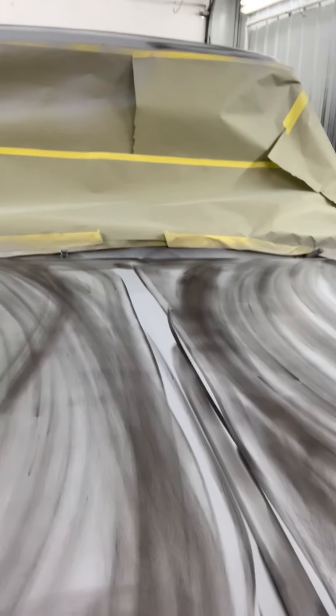This way you can see where you have sanded or where you haven't, and if you sanded enough — did you get out any scratches that are underneath the primer, did you blend them in? I'm going to go over this with 150. I'll block this all out with 150, prime it, then block it again with 150. Some people go to 220 on their second block, but I got such a good primer I'm really not worried about it. So I'll prime this again and we'll block this twice with 150.